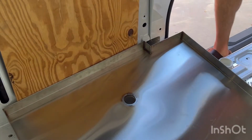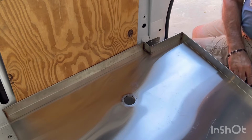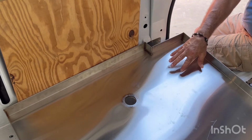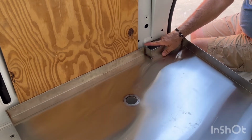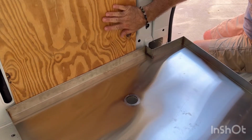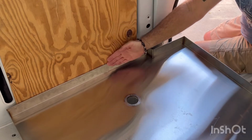All right, another sweltering day in North Dallas. Okay, my friend, so I got this really sort of goofy two slider situation. So custom build, custom shower pan, stainless steel shower pan build. And I'm just lining up. So I got a notch here. I have a piece of half inch back here that'll need to be built out, right? And then another piece of wood on here so that when I do the final seam connect and caulking here, there'll be an overlap across here.